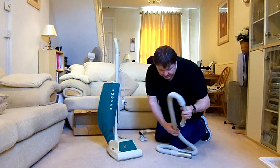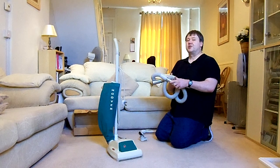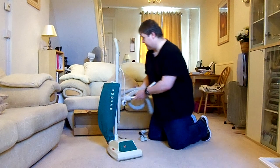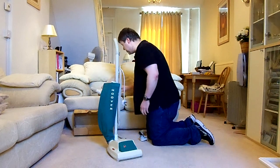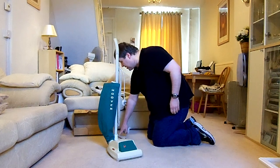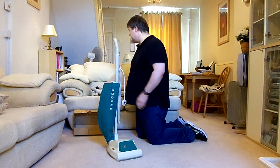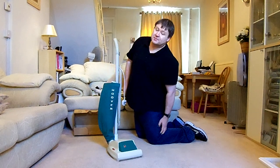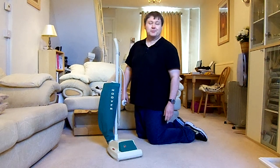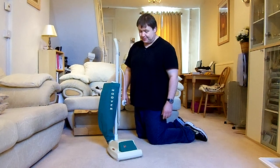Because with the senior, the 652, the belt actually stayed on the spindle at the time, so there was always a big hole in the converter which used to leak suction. So even though the cleaner was a more powerful unit than the Junior, I don't think that they would have had as much suction. Now I have got 652s upstairs and a Hoover Ranger, Senior Ranger. Unfortunately I haven't got the tools for it though, so I've got no way of comparing, but other people have done videos on YouTube of it.